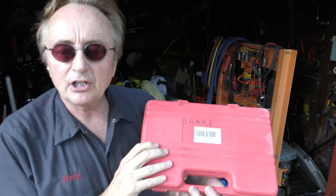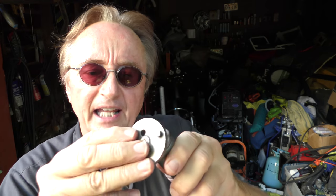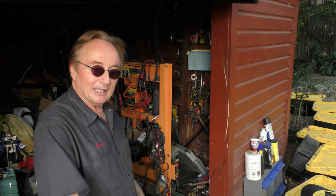If you want to do your own brake job but don't have the tools, you're going to love this brake retractor set. It squeezes the pads back in — very simple design — and with all the different adapters it has, it fits just about any car. These are really handy for cars that have rear discs where the emergency brake turns the caliper. When you retract those to change the pads, you have to both turn and squeeze at the same time. A lot of people just grab a big pair of pliers and squeeze the rear calipers without turning them — that breaks the emergency brake mechanism. When they're done with the brake job the regular brakes work, but when they pull the emergency brake, it doesn't stop. If you're working on one of those cars, you need a tool that turns and squeezes simultaneously. I'm giving it away.